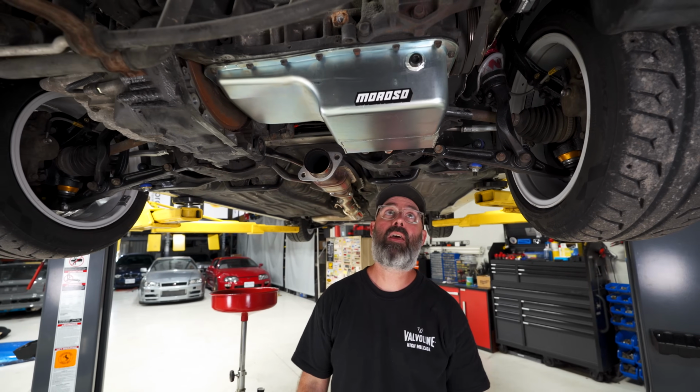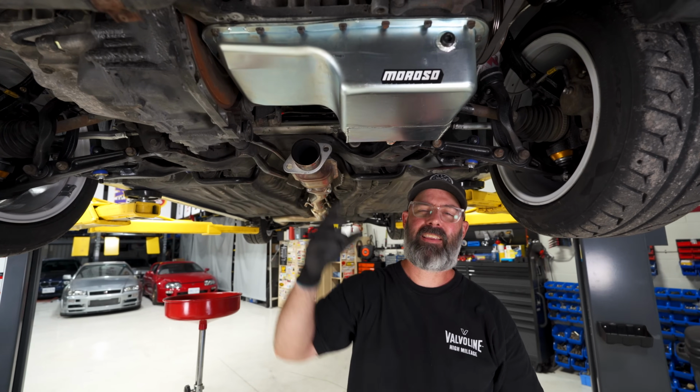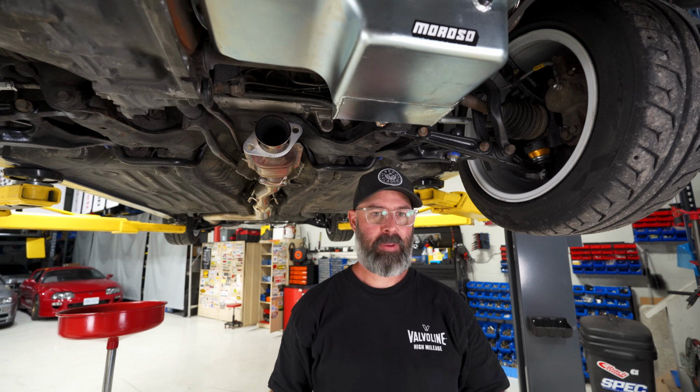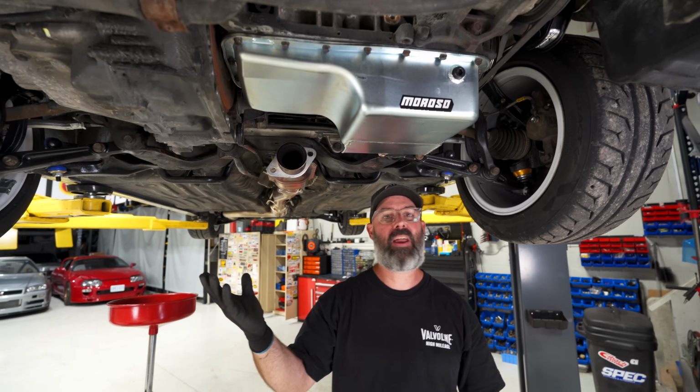Is torqued down after much stress, because as you compress that rubber seal, it gives you that feeling of a stretching bolt or something that's about to snap. But if you use the torque spec in the factory service manual like we just did, it all went in there. We didn't break any bolts.